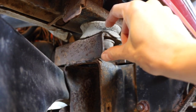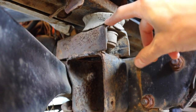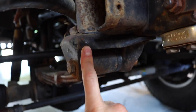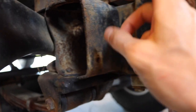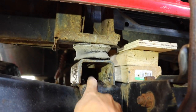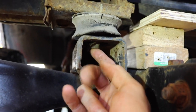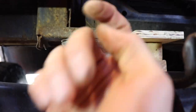It's a three-inch body lift installed on it right now, but it's an inch and three-quarters of a lift in the front, and that's what we needed to make the body lines straight. This is the spring hanger bracket as well — it's all intertwined with rivets. I'm going to have to figure out how to modify this bracket to make it work. I got the bottom portion of this body mount out and have to jack the whole front clip up high enough to clear and remove that sleeve.